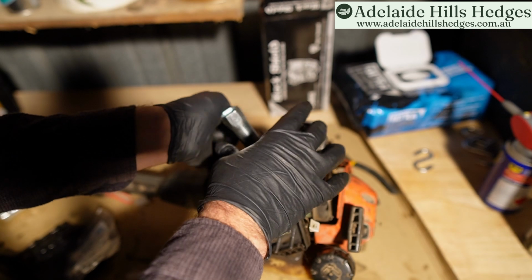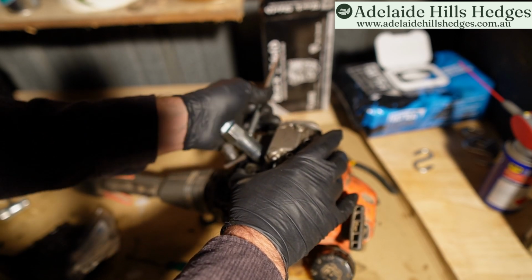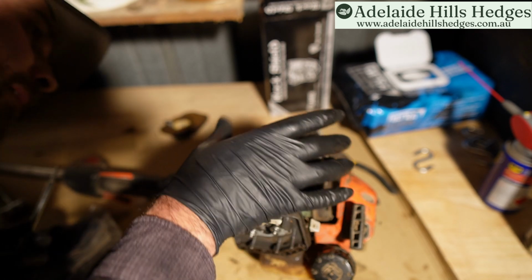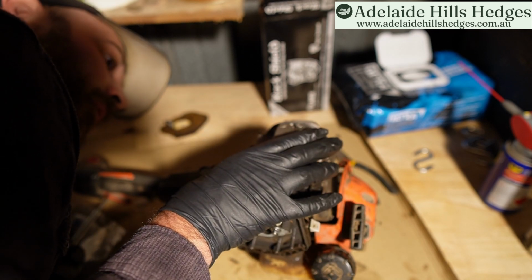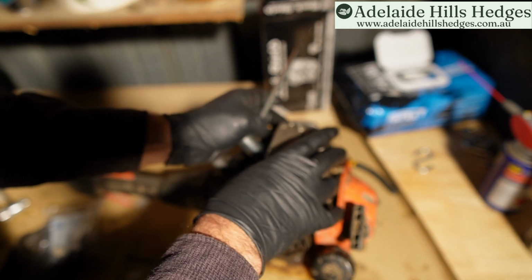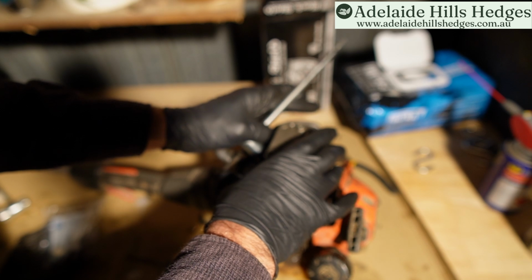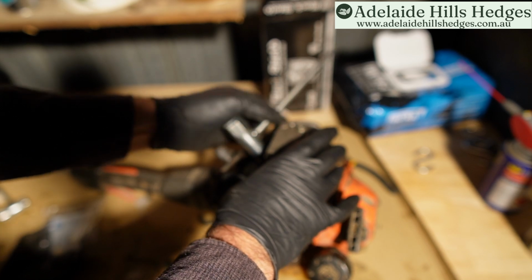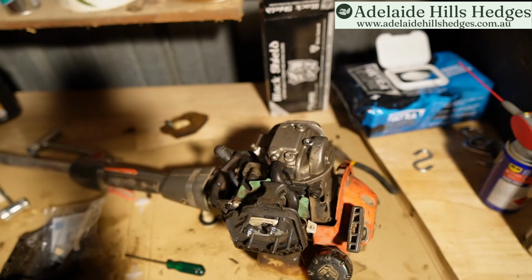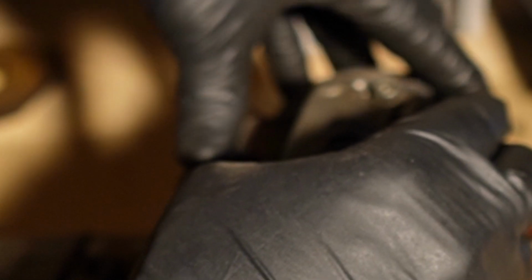And I like to just get these kind of hand tight before I start pulling out the tool. The saw wrench is not the most finesse tool. And don't over tighten these guys. Have a look to see where you're at. You can strip the threads inside the motor and then you're hooped. So I just like to get it till it feels like I could go a little further, but if I do, I could be destroying something. So let's pop that back on.